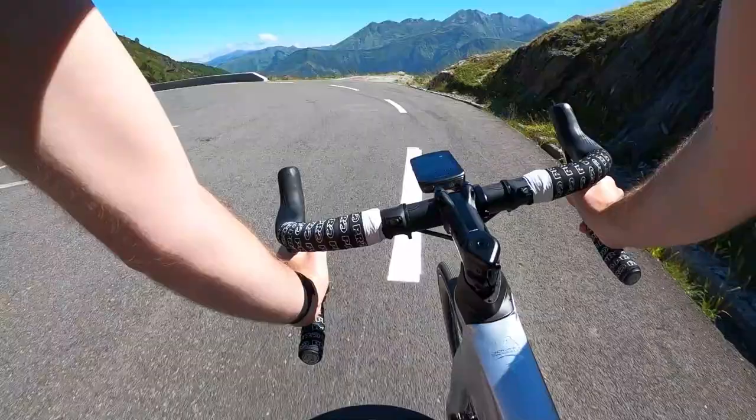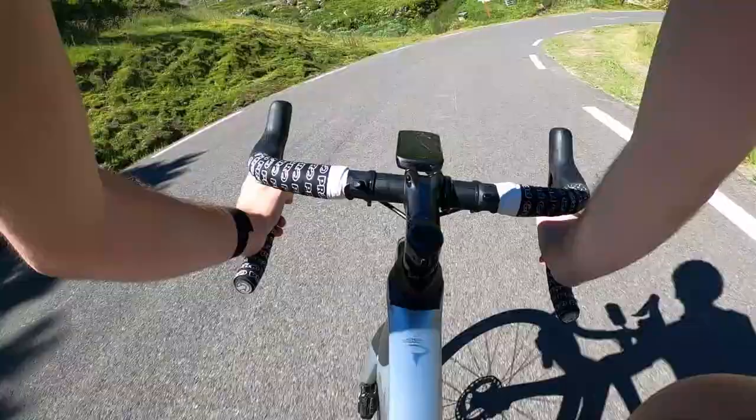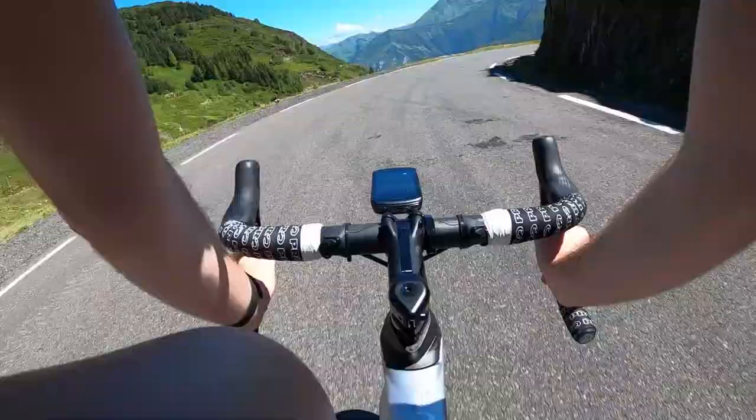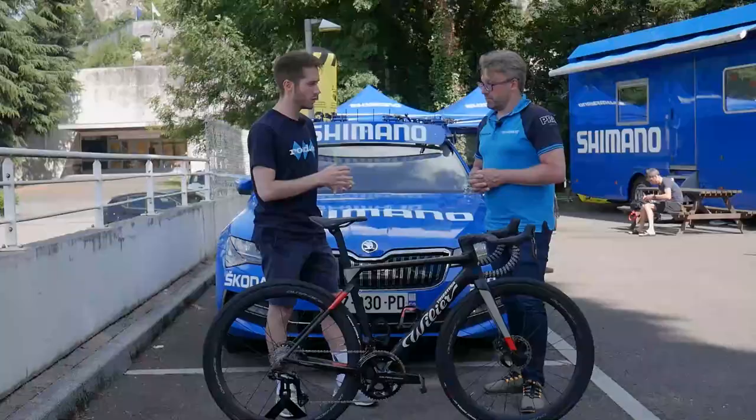It's wireless — so what's happening from the cockpit? A signal is sent towards the rear derailleur. The rear derailleur is basically the heart or hub of the entire system. From there it gets redistributed through the battery by a thin cable towards the front mech, and this harmonizes every action of the entire shifting system.